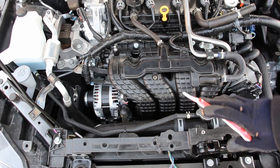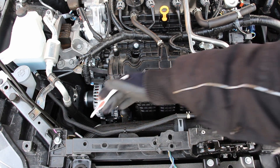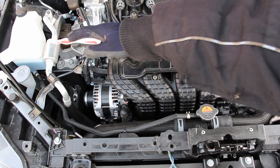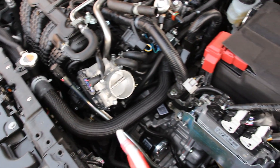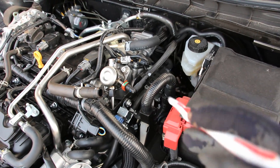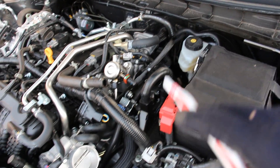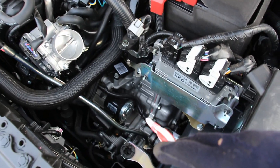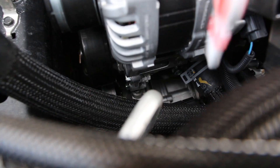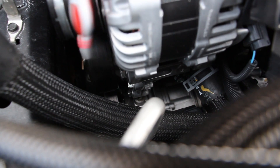Now let's take a look at the cooling system on the Altima — it is pretty traditional. We've got the upper radiator hose that starts here and comes to the radiator cap, and from there we have this small tube that goes to the overfill reservoir. Now that upper radiator hose is going to make its way across the engine and go into the multi-way control valve. That's electronically controlled and is responsible for splitting the coolant off to the heater core, the throttle body, and the transmission, and also houses the coolant temperature sensor. The lower radiator hose makes its way across the bottom of the radiator and goes into the thermostat located inside of here. That thermostat goes into the water pump housing underneath this alternator, and on this side here we have the water pump.